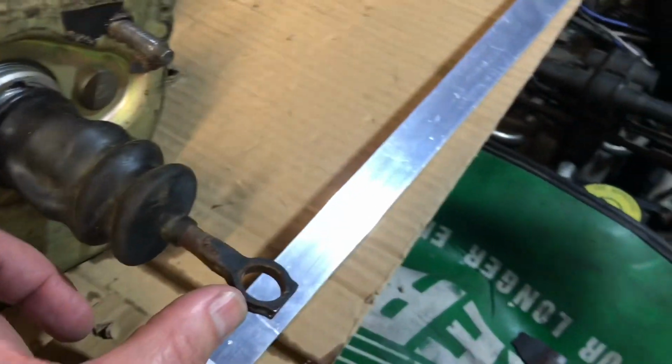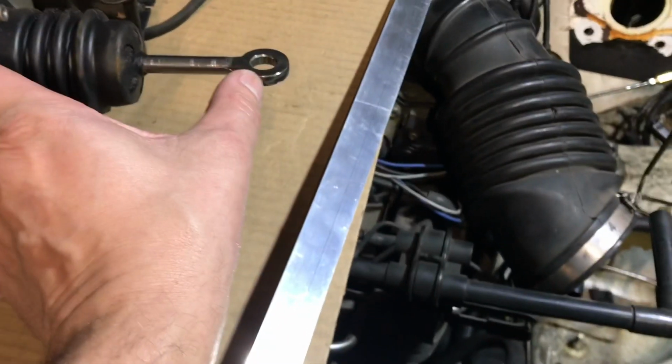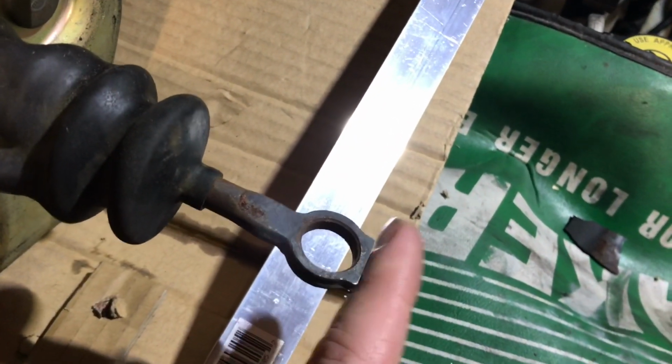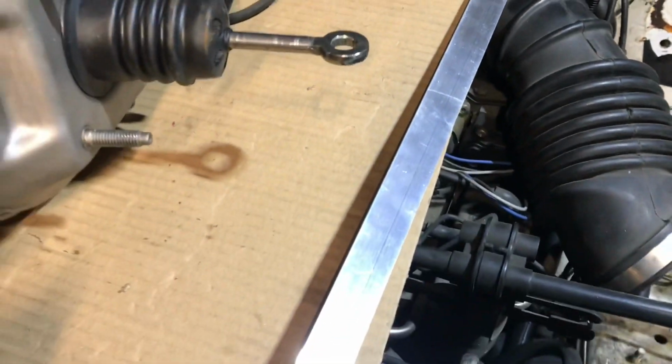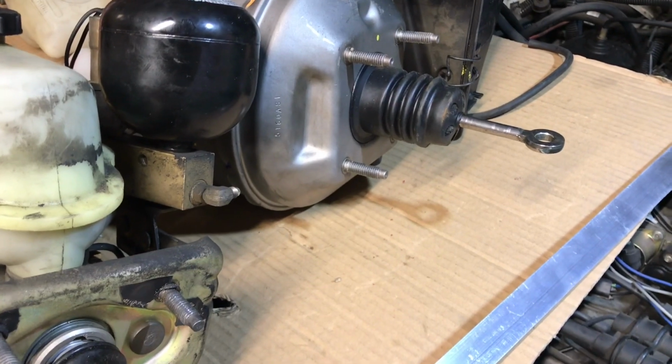And then measuring out, I think it's closer to a full inch difference. It's very hard to measure. Either way, I got to get the hole drilled. I think it's 5/8. And I want to do that flat section. It's going to bring it in quite a bit. And then I'll go back to shimming. If I have to double these up, that's fine.